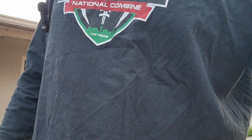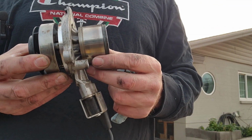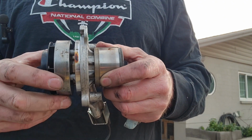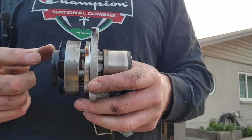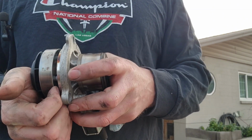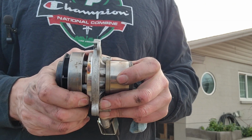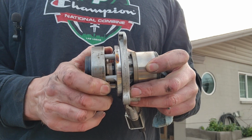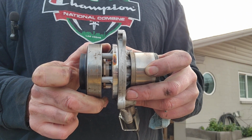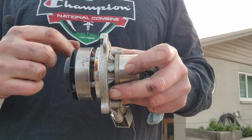All right guys, you want to see some bullshit? Look at this. This is my old water pump. Definitely leaking. You can see corrosion spots right there, right? So Volkswagen designed this water pump. It's pretty fancy. This will actually extend, and I'm only doing this because it's the old broken water pump, right? This will actually extend and close this off so that it only circulates a little bit of water inside the motor and heats up the motor quicker, right? You can see it pops open and then it'll circulate more.